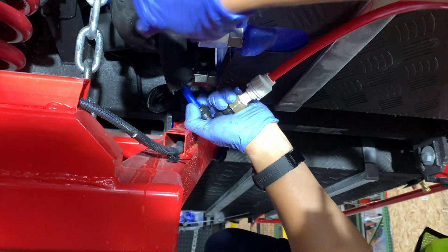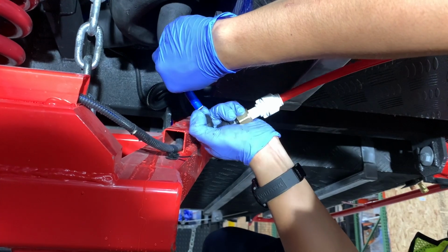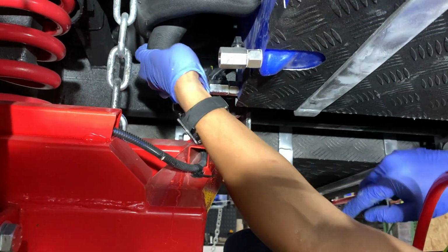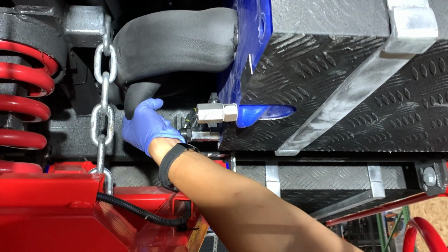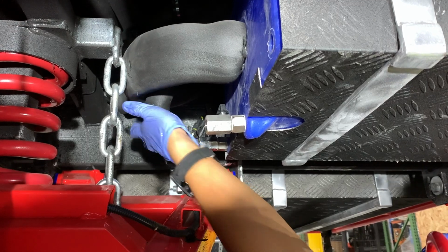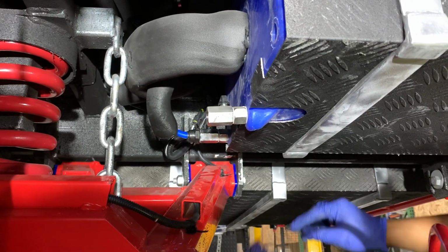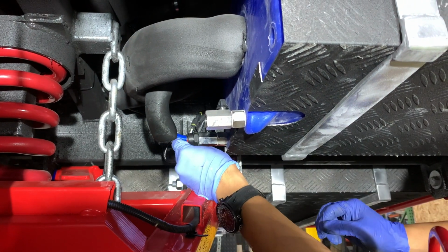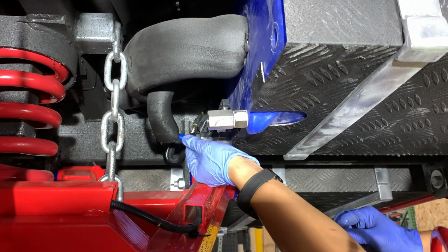Again, you're going to push on the bottom of that valve so you can get that siphon tube off. You're going to replace that back into where it goes. Again, you gotta be a little tactile with this because of the positioning for it. So once you get that put on, you're gonna put your retaining clip on. There we go, and we're just gonna go right on the end there. We're gonna push that right into place. Make sure that's secure, very good.